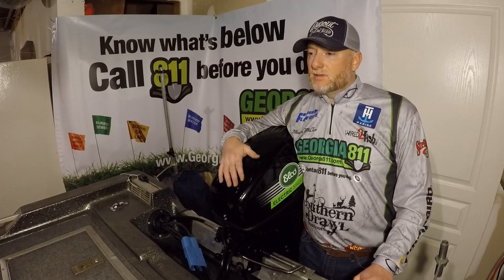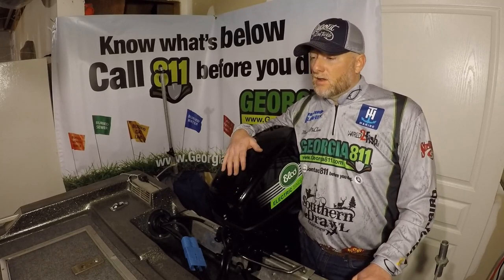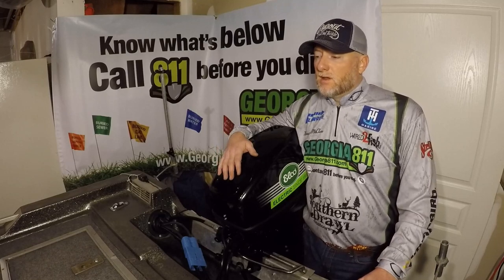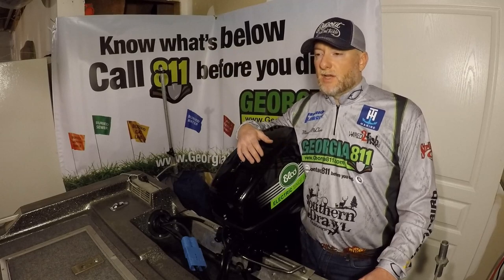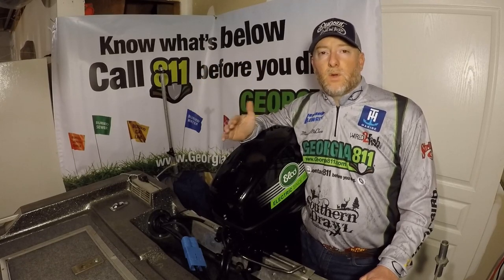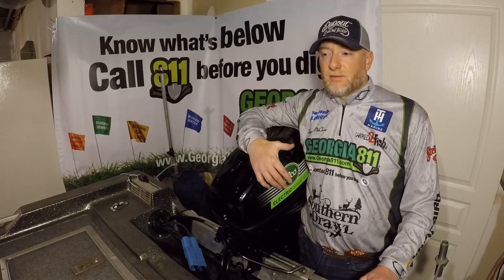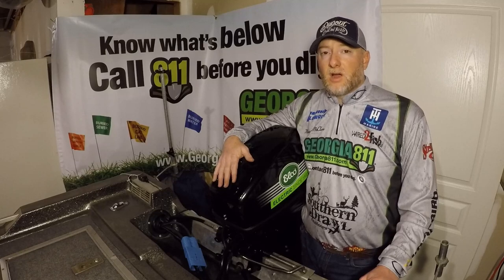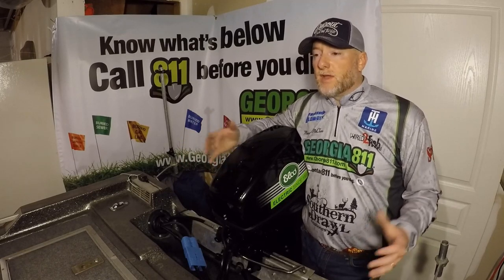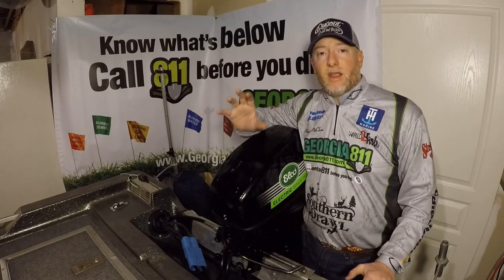If you don't know what 811 is about, it's involved in every one of our lives. Say you have to move your mailbox, or move some shrubs and flowers around your yard, and you've got to dig and excavate, and you think, well, I'll be all right, I'll go out there with a shovel. A lot of people don't realize there are utilities everywhere underground. One simple call to 811, taking a few moments out of your time, can do it. There are other options as well. You can go directly through their websites, as well as a phone call, and get notification out to all the different companies. That's what 811 is about. They coordinate all of those companies together so they can locate all their utilities in the ground and clearly mark them.